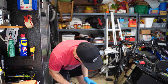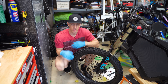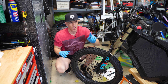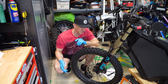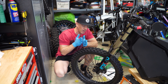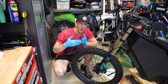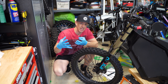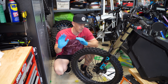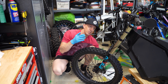When you mount your wheel back up, remember you've got your brake disc on one side. This tire is thicker so it's a little bit of a squeeze getting it in there. One super important tip when you have your wheel off: never ever pull in the lever on your brake. These are hydraulic brakes — if you pull that lever it's going to compress the piston in and create air in the line, because there's nothing to put resistance on that pad with no disc there to stop it. You'll probably have to re-bleed your brake line, which is a massive pain.